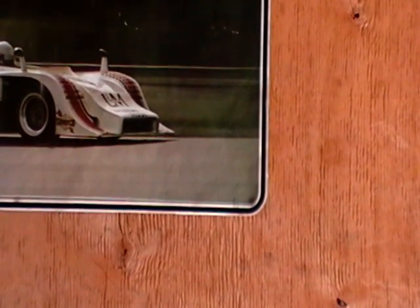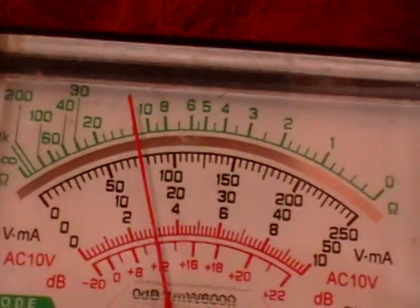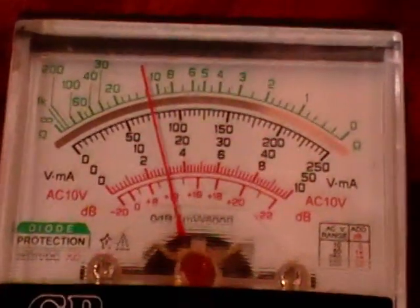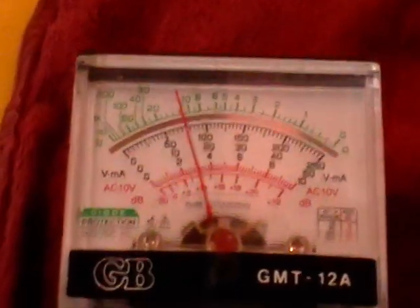Okay, she started. Go ahead and hook it up and we'll see what the meter reads. That's down to 12. That thing's supposed to be reading around 14 to 15, and it's reading at 12. So somehow it seems like we're not getting sufficient charging on this battery to keep it charged.